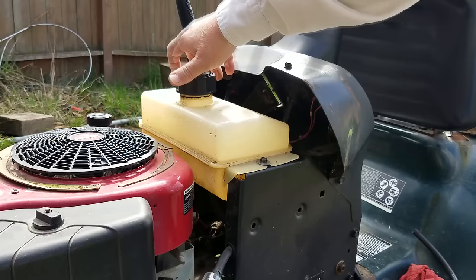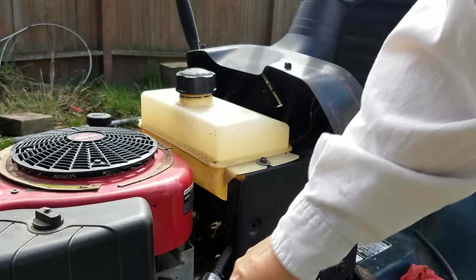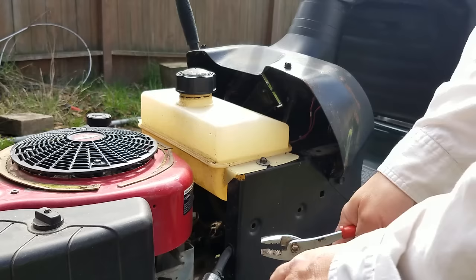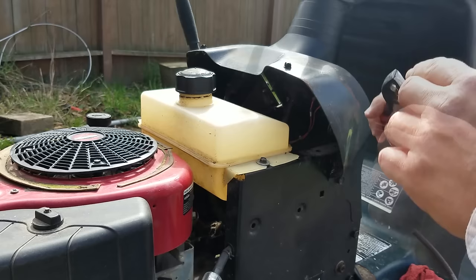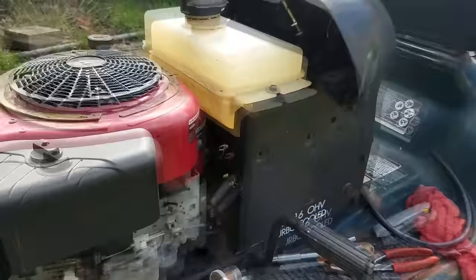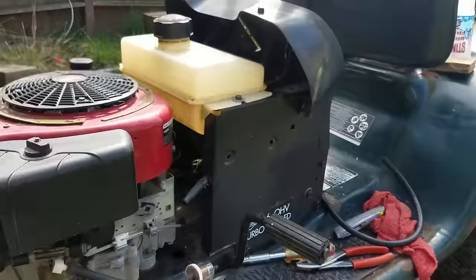I notice both pieces of my fuel line are bad. I've got the one that goes from the tank to the filter — that's plugged — and then the one that goes from the filter to the carburetor itself, and that's messed up too. So here's what we're going to do: with pliers — good pliers — we're going to take off this fuel line. Even though I've got half a tank of fuel, I've just got a few drops coming out, so that's not enough to feed the demands of this engine. I'm going to take the tank out.